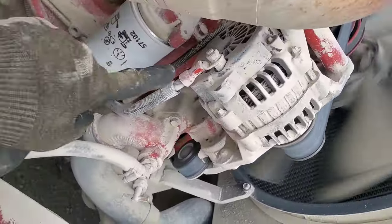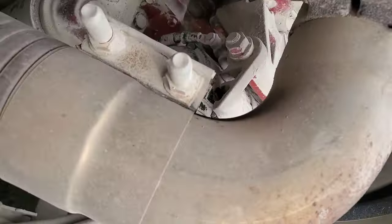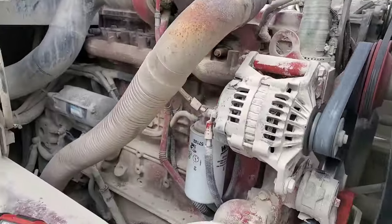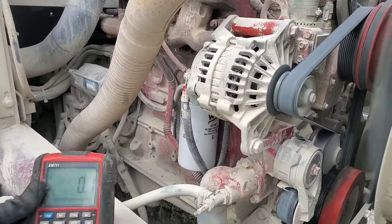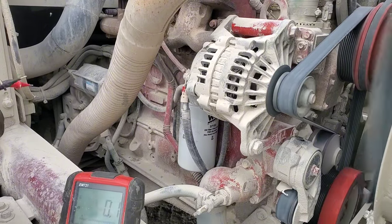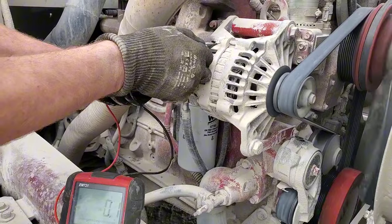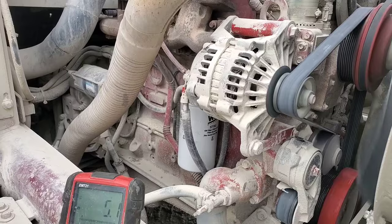This truck uses a one-wire alternator — that's your battery charging wire. This is your control circuit below. You can see it's not hooked that far. So let's see if we're charging at the alternator, in case we've got a broken wire or something. Ground to case on the alternator wire. 12.4 volts — that is not charging.